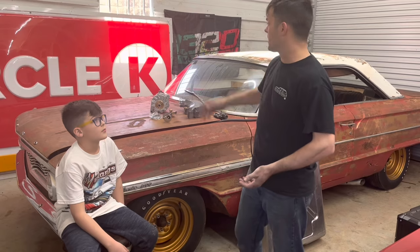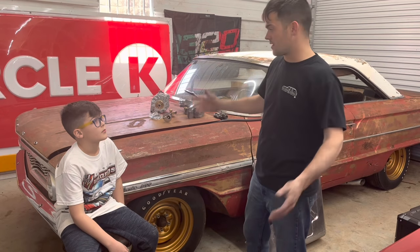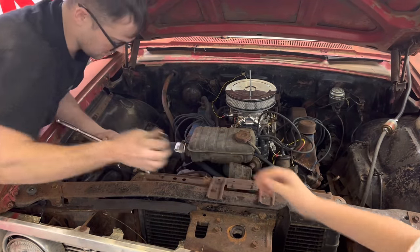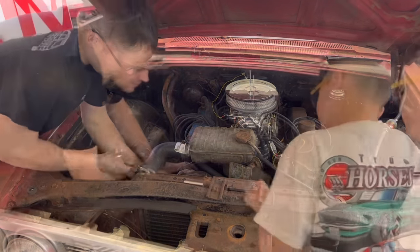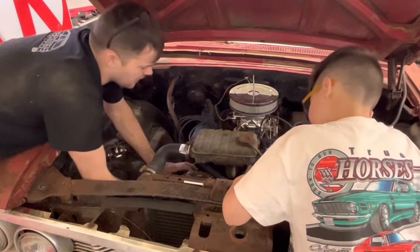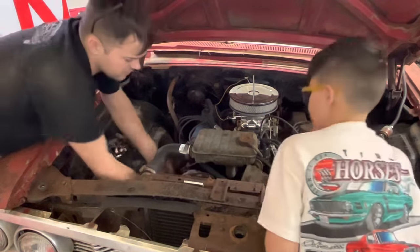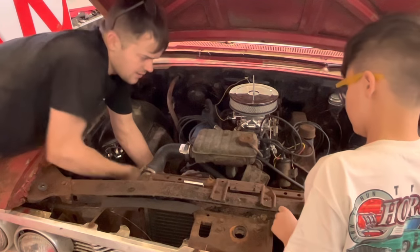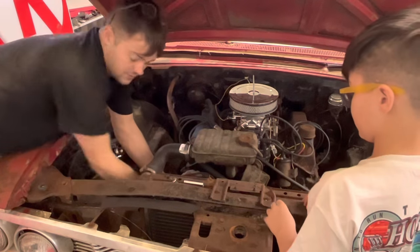We've never driven this thing out on the road because our brakes failed this last time, right? Yeah. Ralphie, can you hand me the 9/16? It's on the parts washer. Thank you. So the bottom bolt is a 5/8, a big long bolt with a spacer. The top one is a 9/16 on this thing, which, who knows, it's probably been changed over the years.